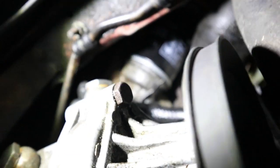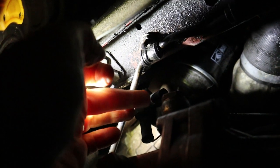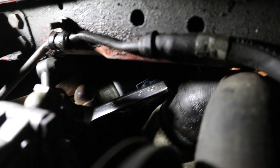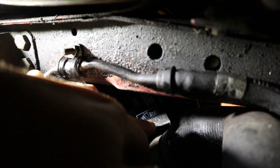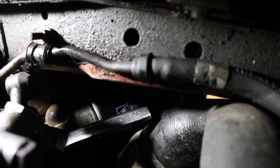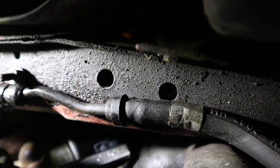So we're under the front of the car, the driver's side. You can see the steering pump here. Just up in there is the oil filter, and then directly underneath it, that is the oil pressure sender. We disconnect the electrical connections to that first, then see if we can unscrew it from the car. Electrical connections are off and I managed to get the 24mm on there. But my fingers aren't strong enough to break the seal because there's hardly any leverage — I've cut half the shaft of the spanner off.